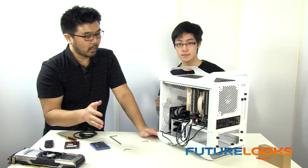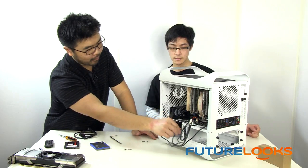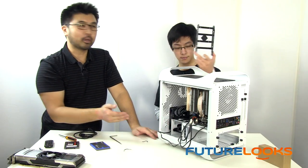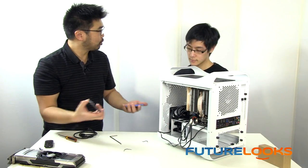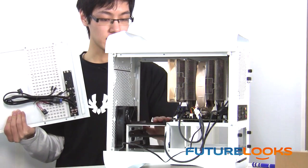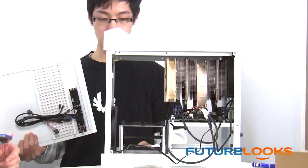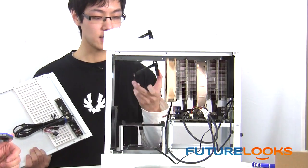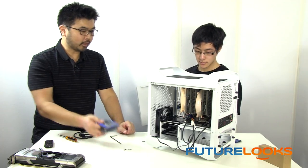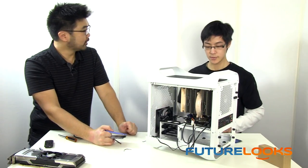The next step is to plug in our SSDs. We haven't lost all drive space — we still have space for two 3.5-inch drives, but we can also mount 2.5-inch drives in five different places: two mounts on the side panel, two on the wall if you remove the hard drive cage, and one on the floor. And even if you keep the drive bays in, you've got 2.5-inch mounts on the hard drive slides. For cable management, you might want to pull out the drive bays to shove cables underneath — you can even zip tie them down.